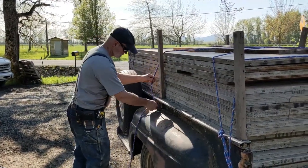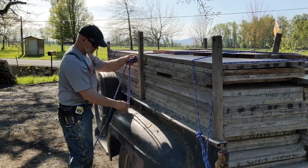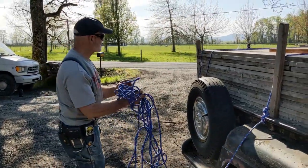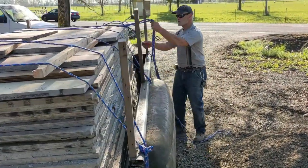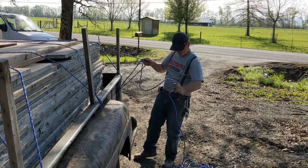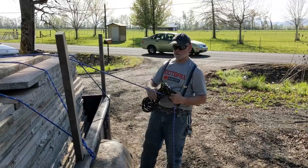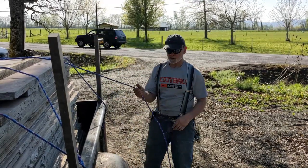It usually doesn't take long to put the knots you need on a load. The most important thing is to get the center of gravity of your load in front of your axle — having weight behind the axle will affect your stability and can wreck your vehicle. The other thing is to make sure that all of the load is tied. These forms are very slick, so when you step on the brakes they're going to want to slide. I save the stiffest rope to put over the front of these to secure them so that if I have to slam on the brakes they won't shift. You can usually accelerate gently, but you can't control how hard you might have to brake.